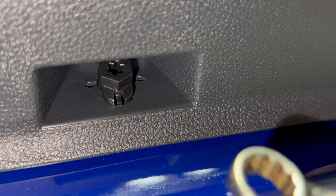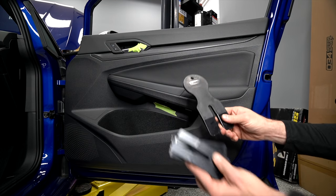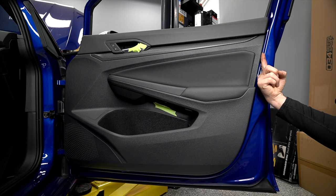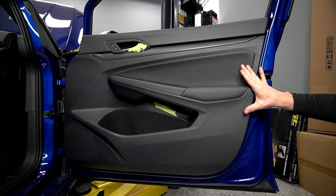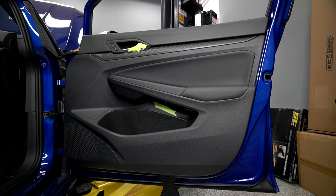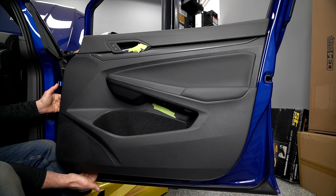Now it is time for one of the two worst parts of this entire job — taking off the door panel. There are pretty much three clips on each side that need to pop out. Volkswagen recommends using trim tools to get behind the panel and pop it loose, and that works really well. There is one special clip up here that I like to push up and slide out, because you have to push the door panel up anyway. I like to start at the bottom in the middle, right where that quarter turn was, getting around it so you're not prying up against it. Then I'll get my hands behind the panel and just kind of pop it loose — once this side is done, do the same thing on the inner part. Now we've got our panel completely loose.